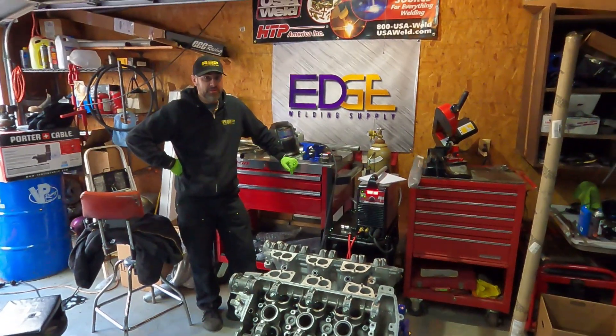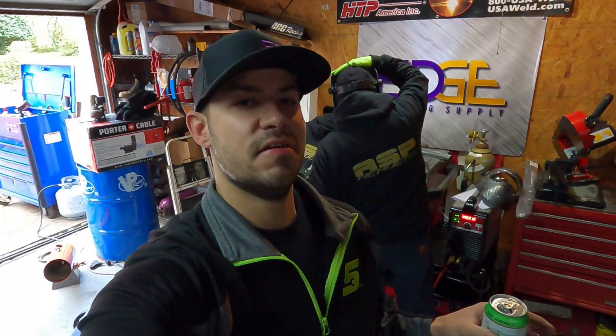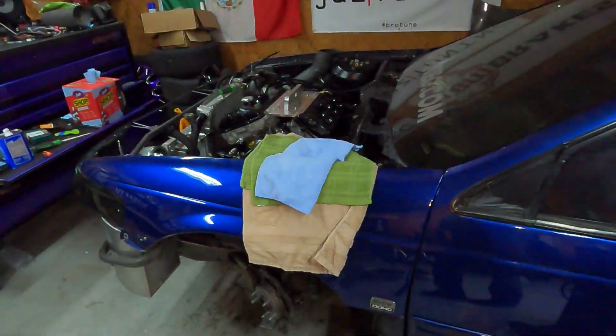We still got a couple left on the turbo on the blue turd, so we got a little bit of that. Their headers might be done but I'm nowhere near done, that's for sure. Stefan is welding up some of the collectors because we've got to get these things expanded out so that all the V-bands work, and then we're going to take them over to the exhaust shop to get these things expanded so we can throw them on.